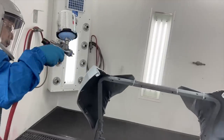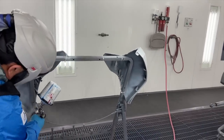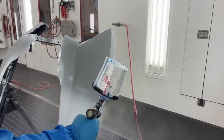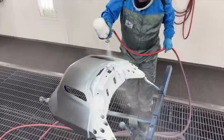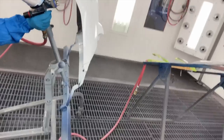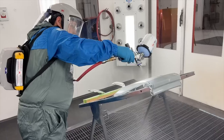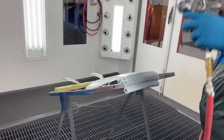The first thing to be sprayed onto each panel is a sealer, or seal coat — sort of like a primer. It covers up the original color and gives the base coat something to stick to. Juan decided to use a white-tinted sealer, which is actually a pretty good idea. One thing I found rather interesting is that at no time during the entire process did I ever smell any paint fumes — a real testament to how well this paint booth draws out all the particulate matter that doesn't stick to the parts.